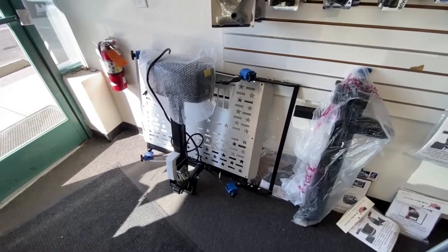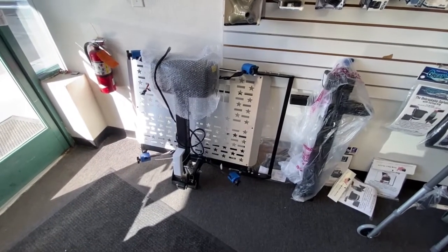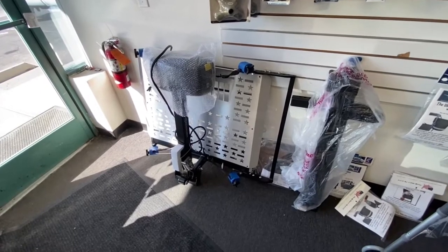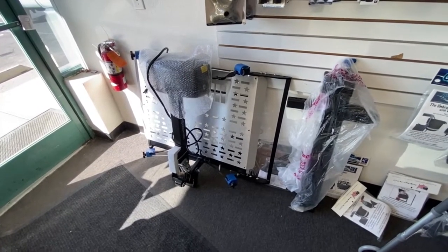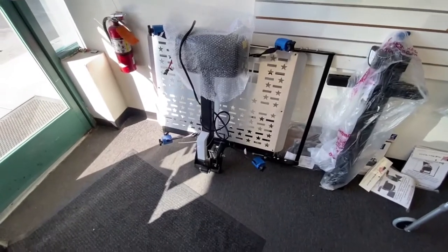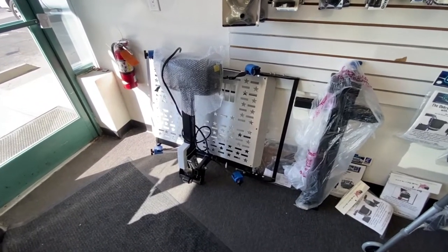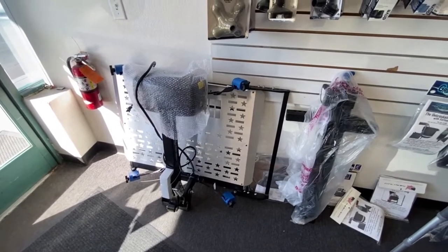With towing, you have an axle which supports the weight of what you're towing. What these lifts rely on is what's called tongue weight, and tongue weight is usually 10% to 15% of the towing capacity of the vehicle. So if you have a 1,000-pound towing capacity, you would only have 100 pounds of tongue weight — that's the physical weight you can hang off the back of the vehicle. 100 pounds would cover two swing-aways or one lift without a swing-away. They do make lighter-weight lifts and swing-aways, but they tend to be more expensive than the standard AL100, AL300, and so on. The more lightweight the lift, the more expensive it tends to be.